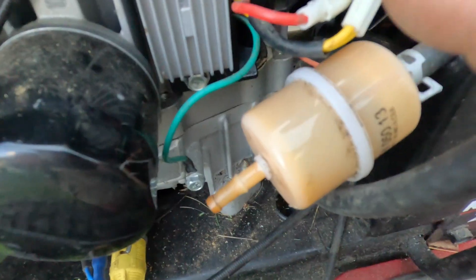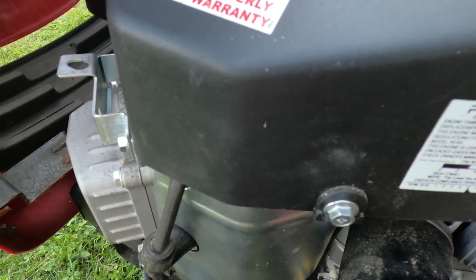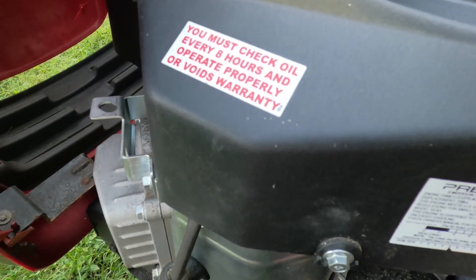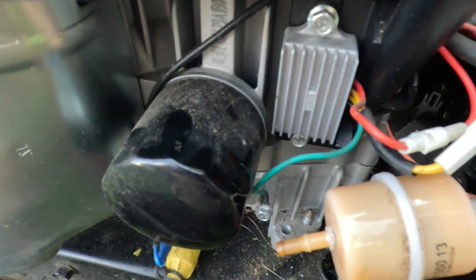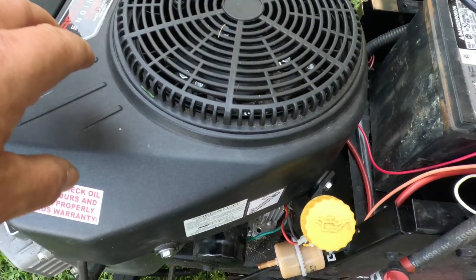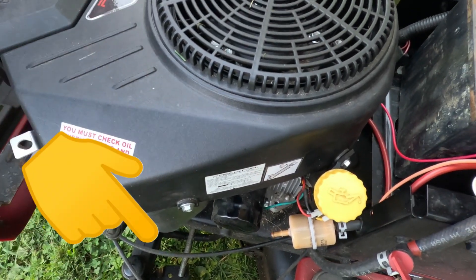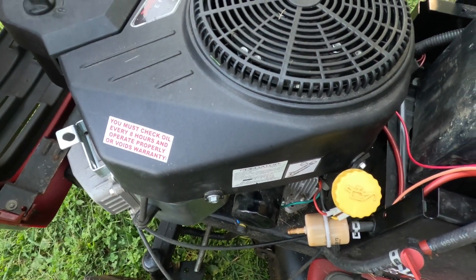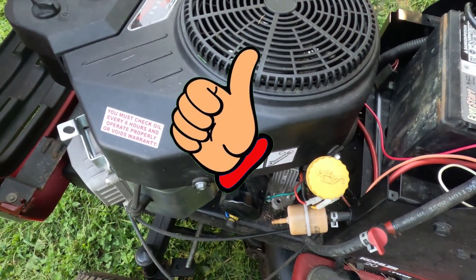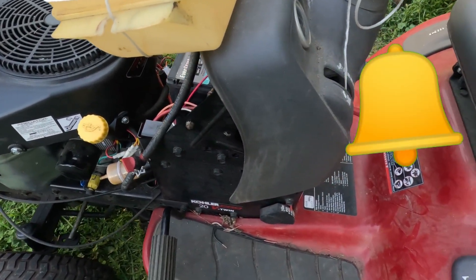Change your fuel filters from time to time, keep your fuel filter clean, keep your air filter clean — big deal on the air filter if you're keeping your older machines. You don't want to buy a new engine or a new machine. Clean that air filter, keep that dust from going in the engine and causing friction and wearing it down. Don't forget to change your oil and filter. If you have any questions or comments, post them down below — I'll answer them as soon as possible. If you enjoy the video, give it a like. Subscribe and hit that bell icon so you don't miss new videos. Until next time, stay safe.